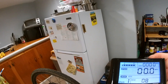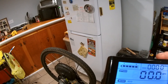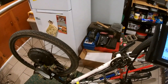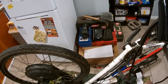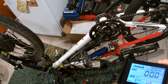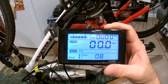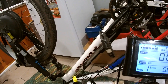I'm getting error 8. I'm getting like 5 volts to my throttle and less than 5 volts to my pedal assist sensor. There's no information as usual. I found a little schematic — kind of an instruction manual — and the error code says error code 8 is a throttle error.